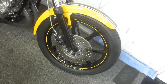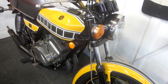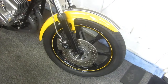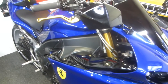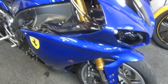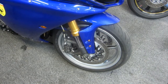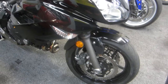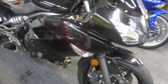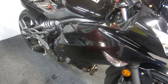On a bike like the RD - a bike that's light and you don't ride really aggressively - the pads last a real long time. On a bike like the R1, which has sintered pads - pads that are more aggressive - they brake harder, but the downside is they wear out the rotors a lot quicker, and rotors are very expensive. On some bikes, friends of mine who cruise and don't do track days are basically using the back brake 90% of the time, so the front brakes will almost never wear out and they'll wear out the back brakes.